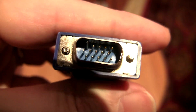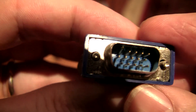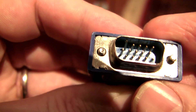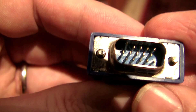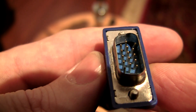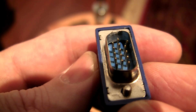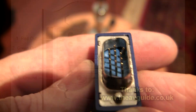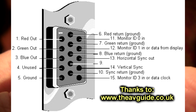You can see at the upper left corner there's a bent pin. We can fix this, but you can't connect it properly without damaging that pin. If you damage that pin, one of the components of the signal might not show up. I haven't memorized what every single pin does — I have a chart for it — but I want all 15 pins lined up properly.